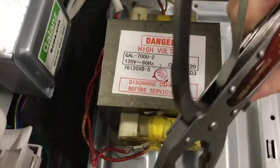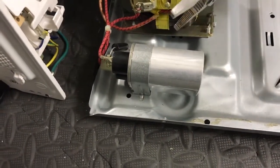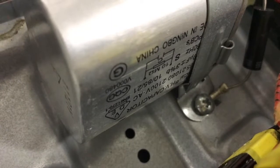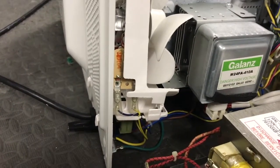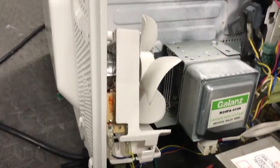This is the smallest microwave oven capacitor I've actually ever seen. There's a diagram on here showing a resistor in parallel with the capacitor, which means there is actually a 10 megaohm resistor inside it. You can salvage that if you want, and it also has some oil in there. But then here's what I was most interested in — there's a little synchronous motor.